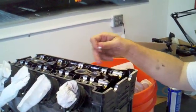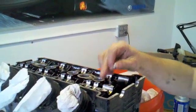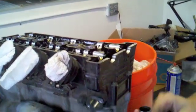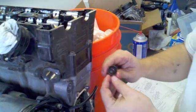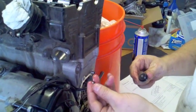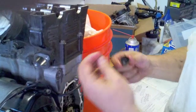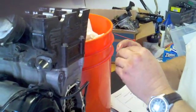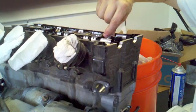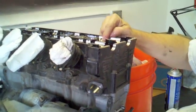If you've never done a valve adjustment, I'll show you what the buckets and shims are all about. Atop every single valve in this motor, both intake and exhaust side, is what we call a shim and a bucket. This piece is called the bucket because when you turn it upside down it looks like a bucket. Usually stuck on the inside bottom of the bucket is a spacer, and these spacers are what adjust your valves. You can buy a kit or just go to your local shop to get small changes in these spacers to do your valve adjustments. This assembly just sits right on top of the valve spring, and the shim sits right on top of the valve stem. The lobes of the cam are what press down on these buckets, which actuate all your valves.